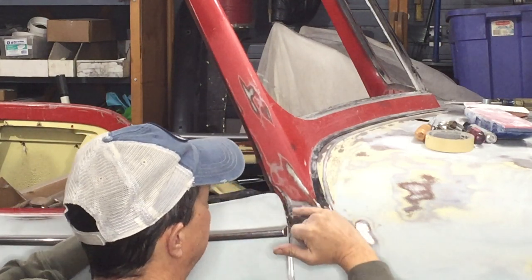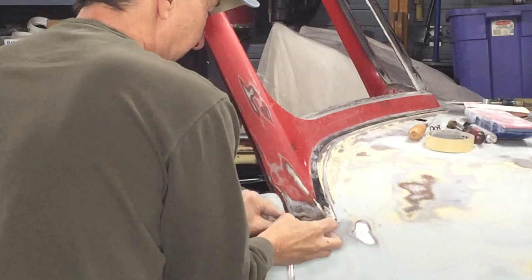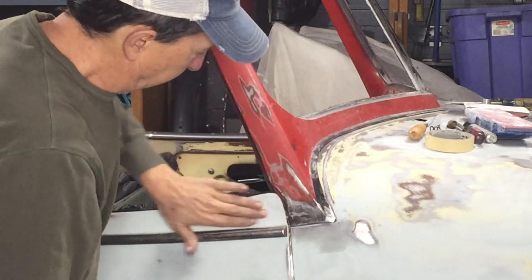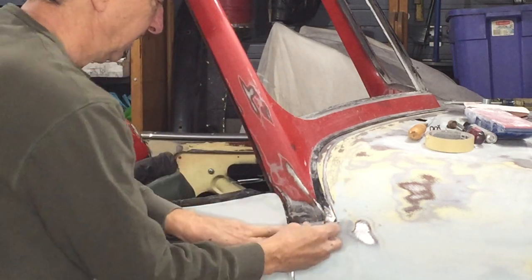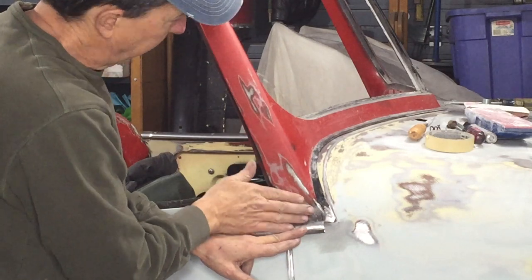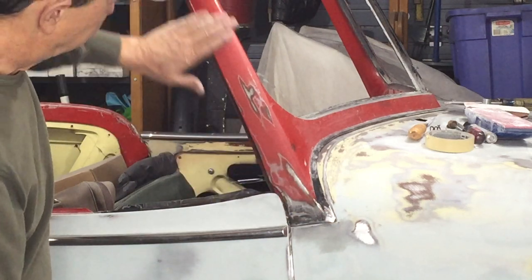This area right here I've got a little bit of a low spot. When I put the trim on, it's tight across the bottom but there's a little dip right here that doesn't quite meet up with the door. So that's just a simple thin filler right here in this area, and then just blend it up into the side of the windshield A pillar. That's awesome.